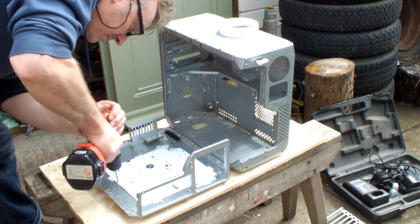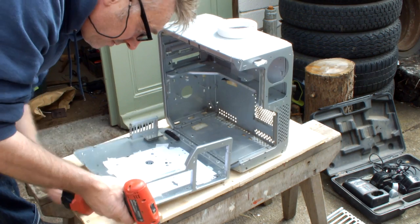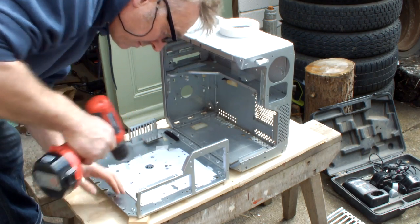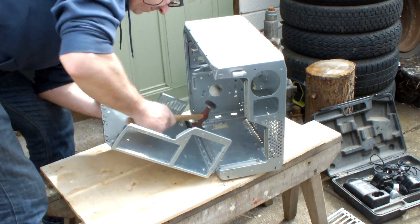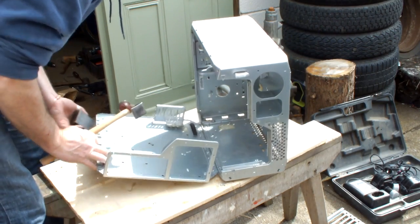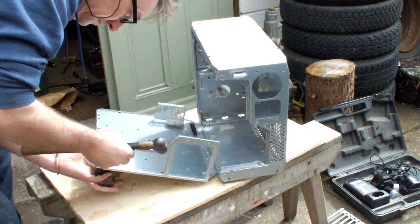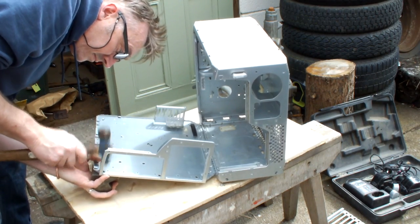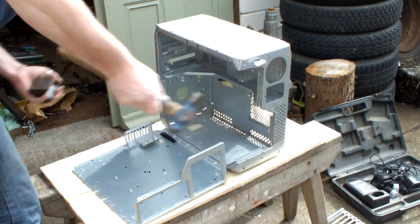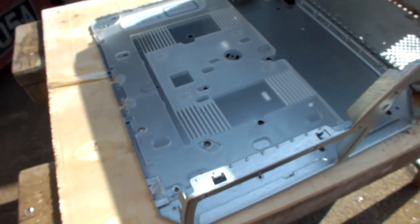My dad is drilling the holes and the guide is showing him exactly where to drill - very handy stuff. This is something you would not have if you had to measure it yourself; you'd have to measure the distance to every hole and probably have a motherboard there for reference. One of the most important things about modifying a computer case is to make sure that nothing is going to short out your motherboard. You could potentially really damage your board if a rogue bit of metal is sticking up somewhere - it could short out and the board could never boot again. When you buy a case off the shelf everything is machined perfectly, but when doing case modifications yourself you've got to be careful and make sure it's all flat.